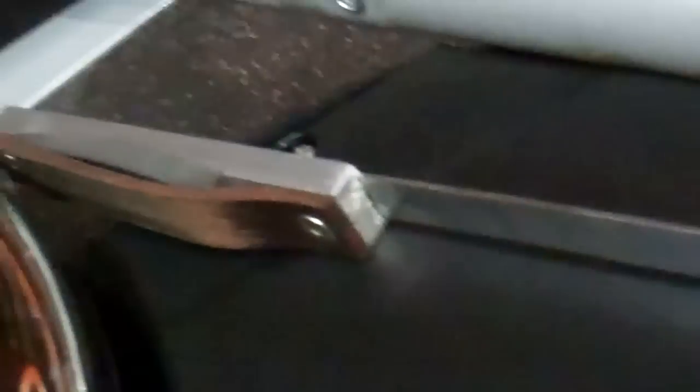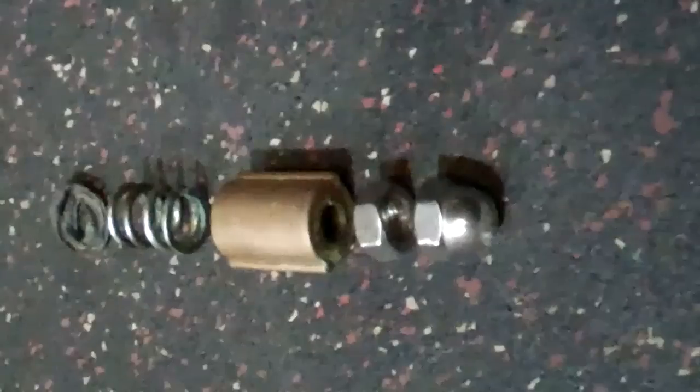To take the rod off — if it's damaged or you're replacing it — remove the resistance pad and the leaf spring. You're going to have two pieces of hardware with washers, and again you'll have a spacer, then the leaf spring, then the hardware. Make sure the washers and the pad are facing down on top of the flywheel. If you put it in the wrong order you're going to get some weird stuff going on. Once you get that off, you'll expose the hardware at the bottom of the rod assembly.